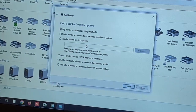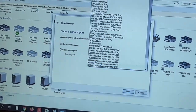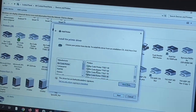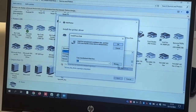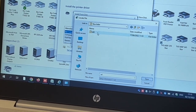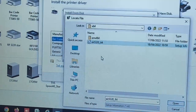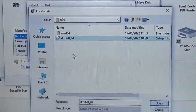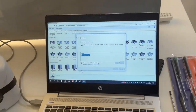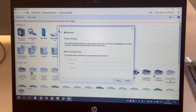Click 'Add a local printer' and click Next. Choose the port — I'm selecting USB 008 — and click Next. Now click 'Have Disk,' browse to the driver location on the desktop. The 64-bit driver file is named SK53520. Select that file only — it will work with this. Click Open, then OK. It shows Speed 40 Star. Click Next, Next, Next, and Finish.